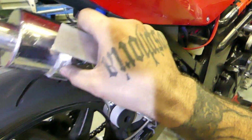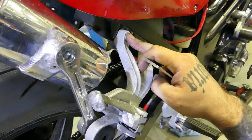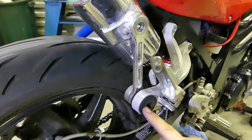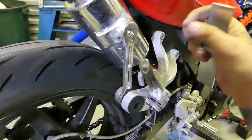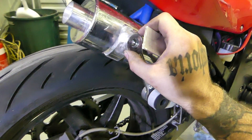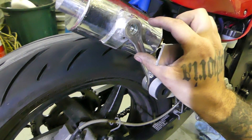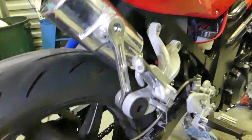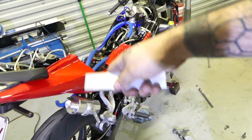I'm going to use this to hold it at its pivot point — the pivot point that I want. So I'm going to weld this to the back and use this bolt here to tie it all in. And then that's all tied together. It's kind of good that this is still on a rubber mount. I'll find a big washer, big Allen bolt, something stainless and shiny. Get this mounted up on the angle that I want — the closer to vertical, the better — because that has it more standing vertically. If I had it cocked on an angle, it essentially changes the effective volume of this catch can. If it fills up to a certain point on an angle it's going to start overflowing, whereas if I have it cocked all the way up, it can fill with that much more volume before I have issues. And with only one tire at the back, issues like that would probably end up being death. So I'll get that in there, weld that up, see what it looks like when it's done, and then run these AN fittings.